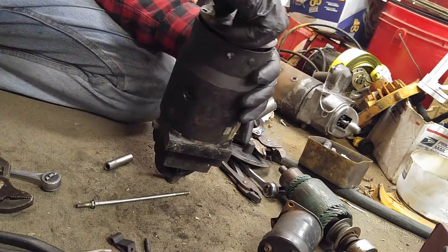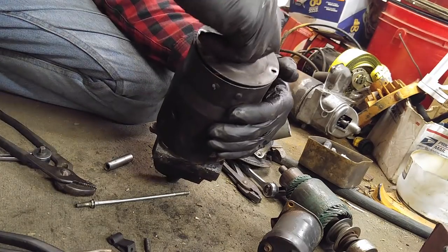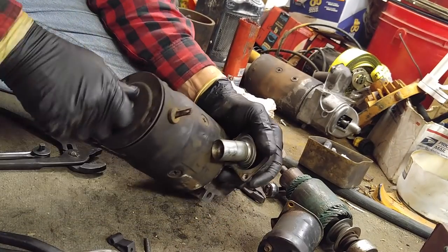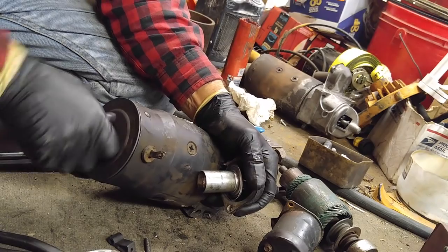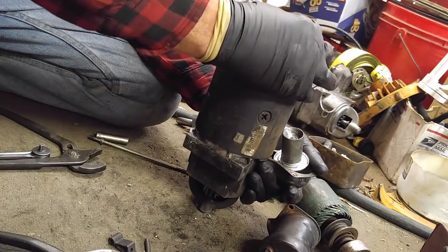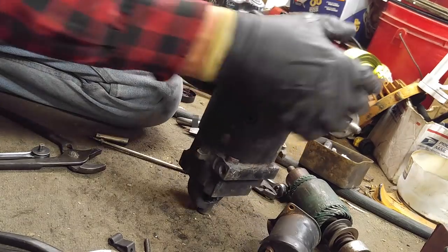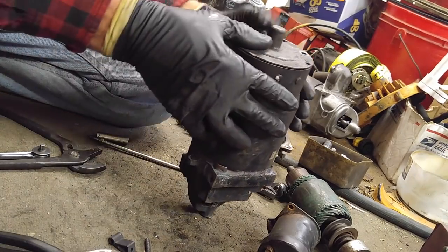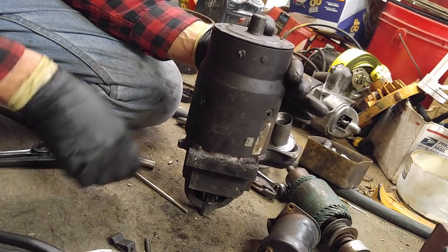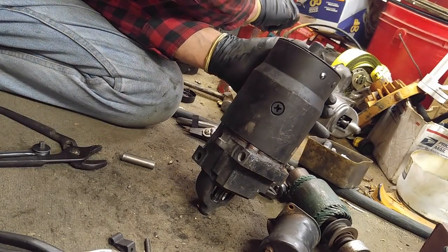And it won't go on because it's hydraulically locked. See a little pinhole here. Got the grease pressure out. How do you like that? Is that tight or what? I guess you just rotate it and the grease will eventually work its way out of the cap. See? There we go. And that goes right there. Almost directly in line with the seam where the case halves are attached together when this was manufactured in some factory in a long forgotten town in the US of A. I'm going to put a bit of grease on those threads. Never have too much grease.